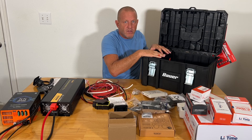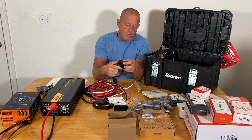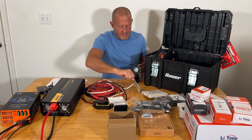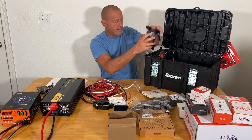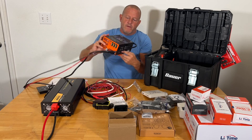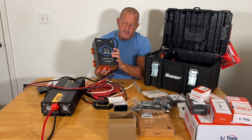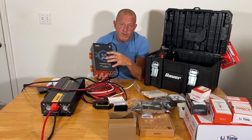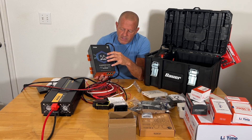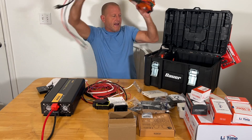This is going to be our 120-volt inlet, which will flush mount into the box. Grab a cord from any wall outlet in your house, plug that in, and it goes into the charger inside — which is the 55-amp converter charger from V-Bore. I've tested this out and it works great. They also have a 45-amp and a 65-amp version. With the 55-amp, you'll be able to charge that 100 amp-hour battery in just a few hours.